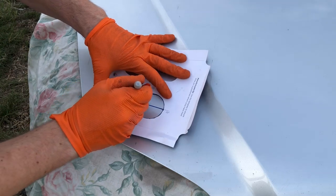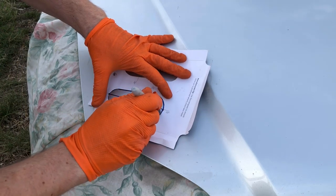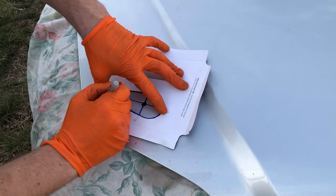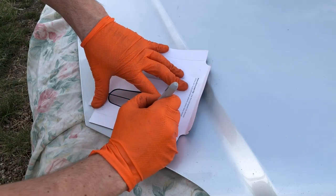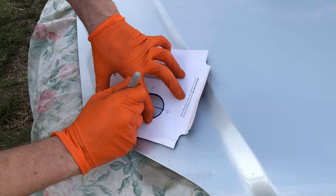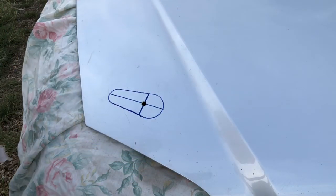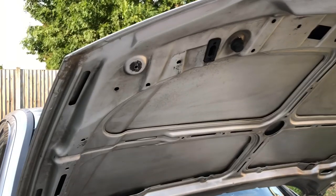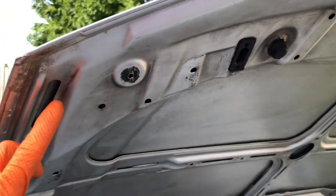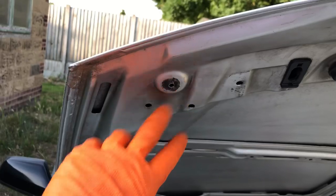Let's get drawing the rest of the template and we can start drilling and cutting out the hole into the bonnet. I'm going to use a jigsaw with a metal blade - never try to use a wooden blade, it's just going to chew the metal to pieces. Get the jigsaw as tight as you can to the template so there's not a ton of trimming to do afterwards. That's the template now ready to cut. I'm going to cut out all this inner skin inside here - it just makes it a ton easier when cutting with a jigsaw so the blade can go all the way through and make a nice straight cut.